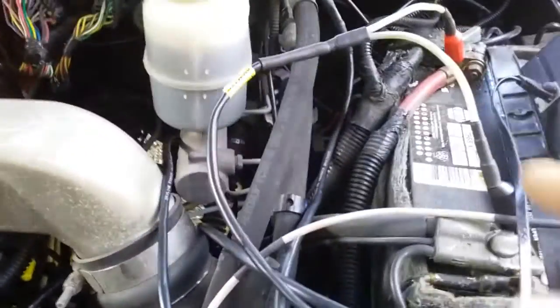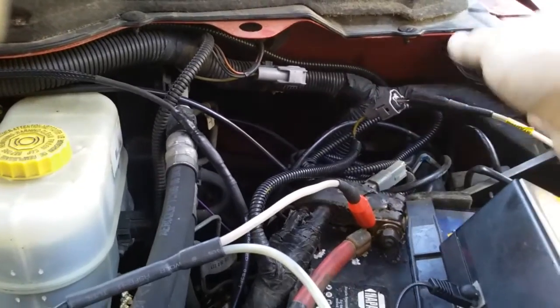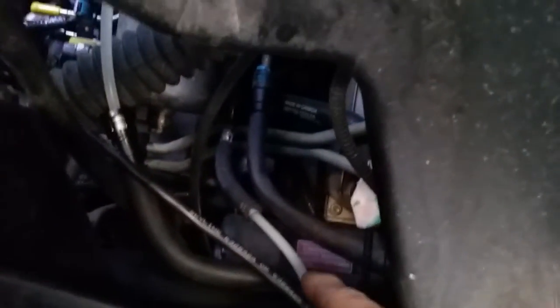We're connected obviously to the battery. We're connected up to the starter relay connection here, or you can go straight down to the starter solenoid and make your connection there. Also down here, this is very simple. You don't have to pull the fender liner or anything else out. This hose just slides up onto the injector return line up here. This is the chassis return, which comes out of our T connection. We're connected from our CP3 return, and this other connection is from the flow meter.